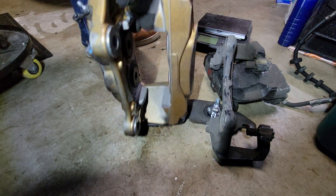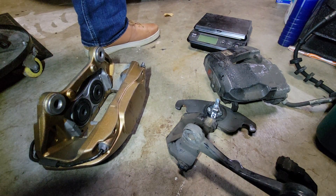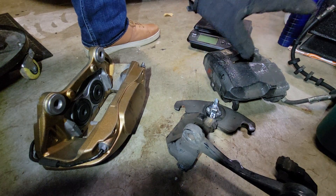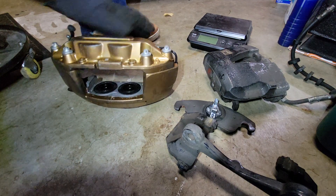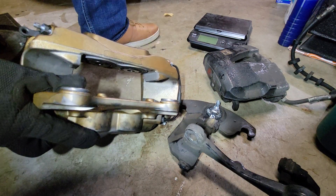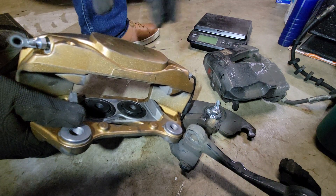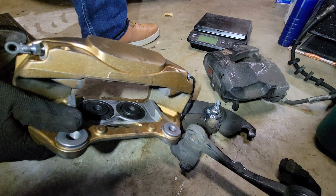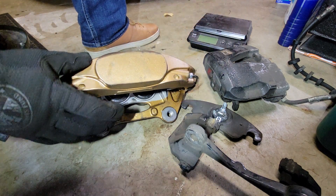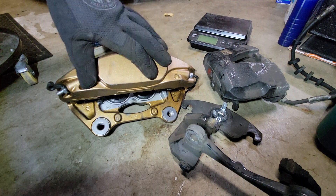This is a very popular upgrade for cars that came with sliding calipers. For example, the C5 Corvette Z06 — although it had a multi-piston setup, it was still a sliding caliper — and they are notorious for failing almost immediately on track. Any C5 Z06 that's been to more than one track day has something like a six-piston Wilwood fixed caliper bolted onto it. You can get these with four, six, or even eight pistons. The more pistons, the better heat dissipation and more even pad application, but there are diminishing returns — the main thing is just to make sure you have a fixed caliper to start with.